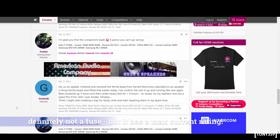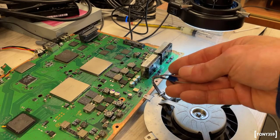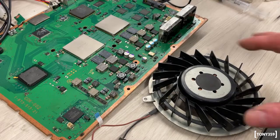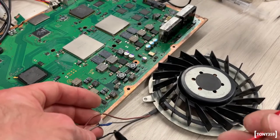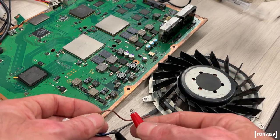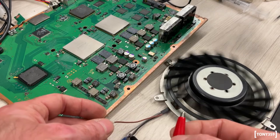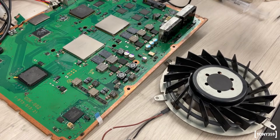The question is now whether that's the only fault. I still don't understand why they did this to the fan. I'll check online if I can power this fan using my bench power supply to see if it works. I found a pin-out online, and obviously this is a PWM fan, so I can't really power it with just 12 volts. But if I give power to the 12-volt rail, the fan spins for a second. So from my point of view, this works - unless the PWM circuit is not working.